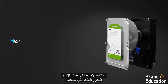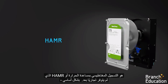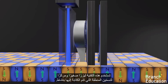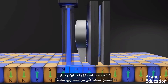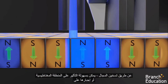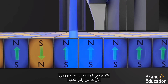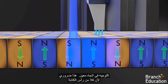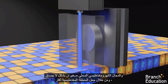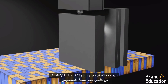The third advancement is heat-assisted magnetic recording, or HAMR, which is not yet commercially available. Essentially, this technology utilizes a small focused laser to heat the region that is actively being written to. By heating the domain, the magnetic region can be more easily coerced to orient in a particular direction. This is necessary because both the write head and the localized electromagnetic field are incredibly small. By making the magnetic region more easily coerced using focused heat, we can continue to shrink the size of the magnetic domain.